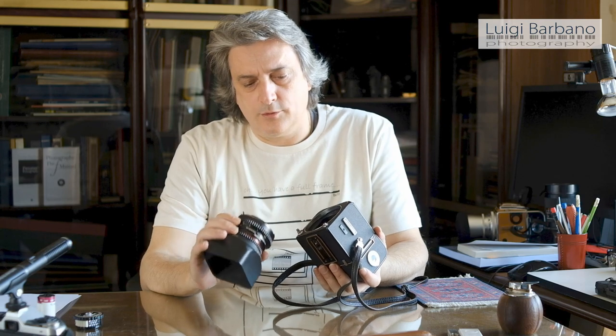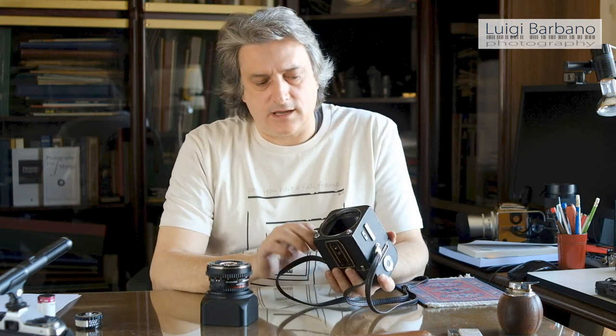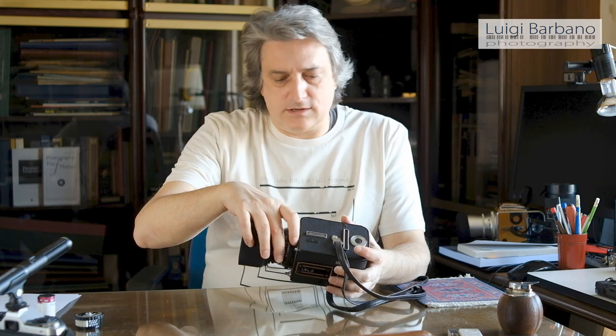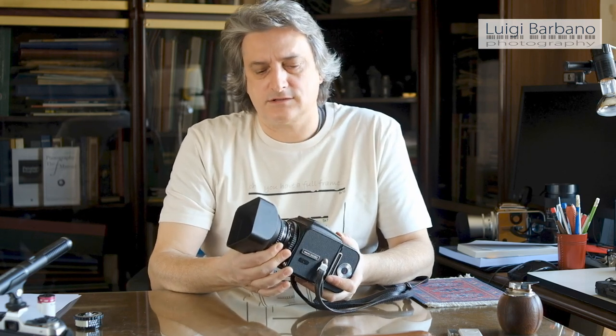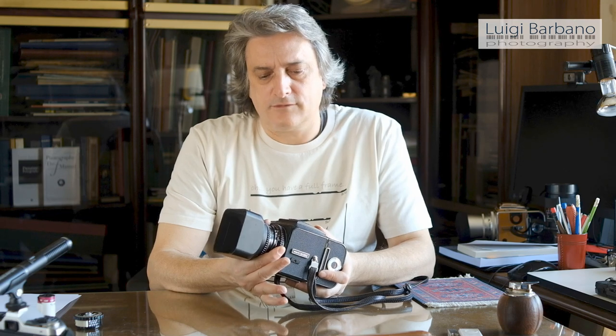One thing I want to tell you: when you put a lens on the camera, it is essential that the camera is wound and the shutter spring in the lens is loaded, because the gear in the body has to fit with the gear in the lens. If they are not aligned because one is not loaded, you cannot put the lens on. Something that I saw many times that really upset me is a lot of photographers — especially newer photographers — who insert the lens, feel it is not going on perfectly, and try to force it. If you feel some resistance more than usual, beyond the normal spring resistance, do not force the lens onto the camera or you will really break everything.